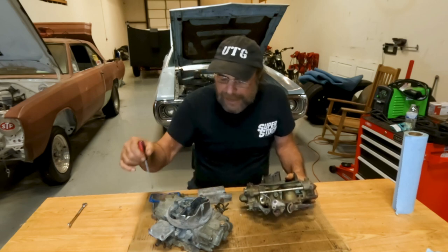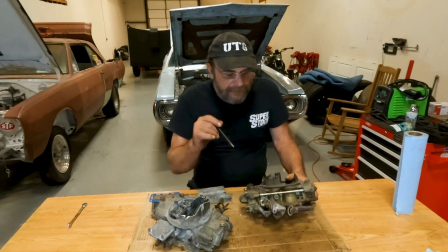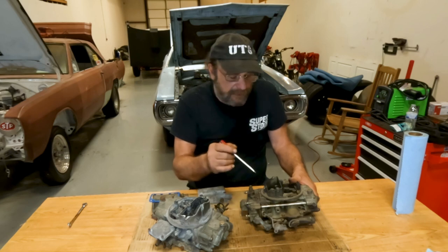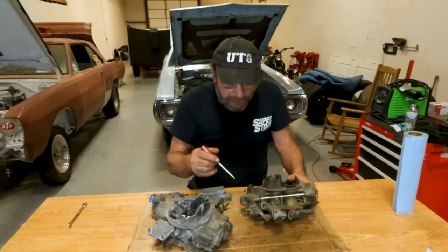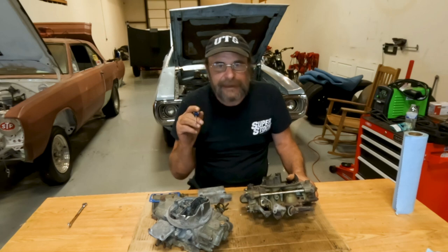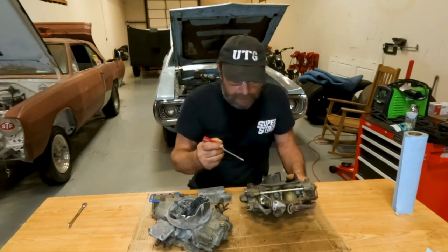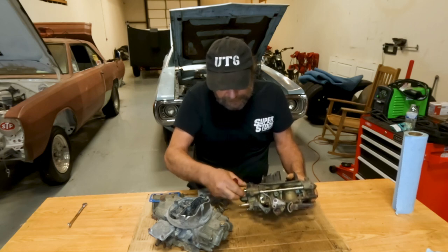This particular carburetor is intended to be a replacement for a spread-bore carburetor — a direct bolt-on replacement for a Quadrajet or Thermoquad — so it uses a single inlet like those carburetors. On larger Holley carburetors with center-hung floats, you don't have this; those have an external fuel line connecting the two float bowls. But on these single-inlet carburetors, you have this transfer tube: one fuel inlet at the front float bowl, and the transfer tube sends the fuel to the back float bowl. That's your point of leakage.